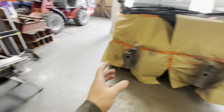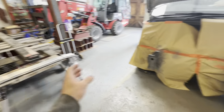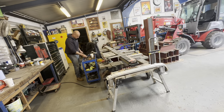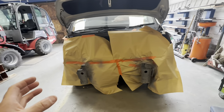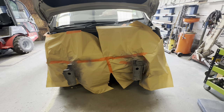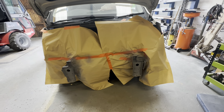We needed the bumper bar. Chris repaired those end caps and just wanted to make sure they slotted on perfectly and everything lined up. It wasn't that hard - they were just a little bit twisted up. Chris proved in the previous video they're only tin, so he straightened those up, flatted them off, got a bit of etch primer on there, bit of normal primer.